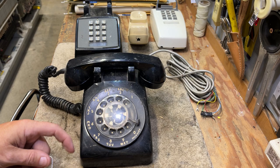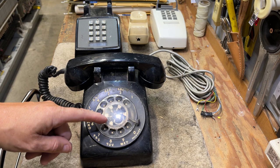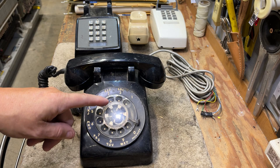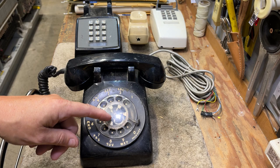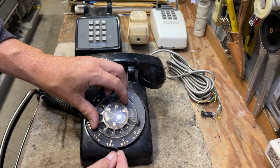This is a Western Electric telephone with an old dial versus the newer style dials, but the finger wheels are the same for the most part. If it had the original finger wheel, it would be slightly different — a two-piece design with a raised section, a plastic cover, and a number card behind the plastic. This one is molded as one piece. However, removing the finger wheels is the same regardless of the age of the dial.